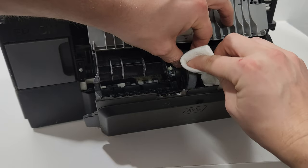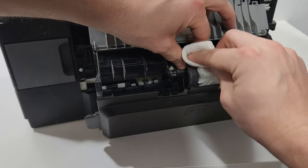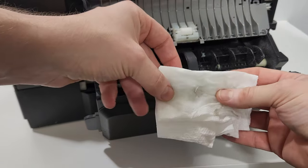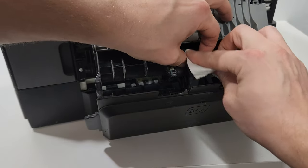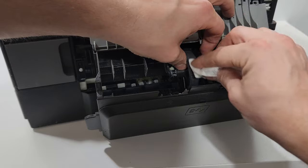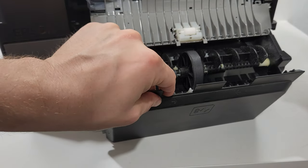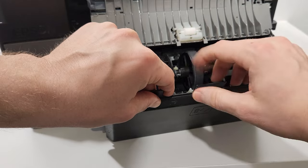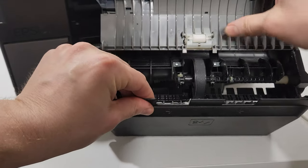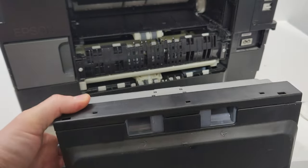You can see it's leaving some residue on the paper towel. It's not really an ink accumulation problem — it's mostly paper dust, though often it's a combination of paper and ink. Don't rub too hard so the paper towel doesn't break apart; just gently clean it. Cleaning this should resolve the paper jam issue in the duplex area, and cleaning the main roller should fix your paper pickup problem.